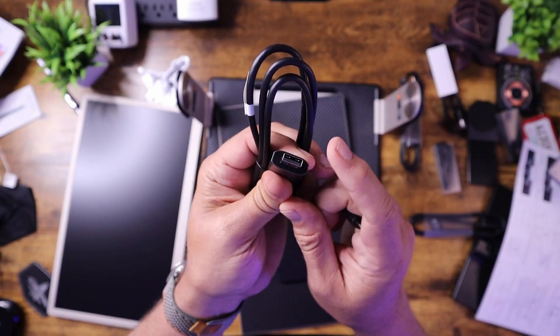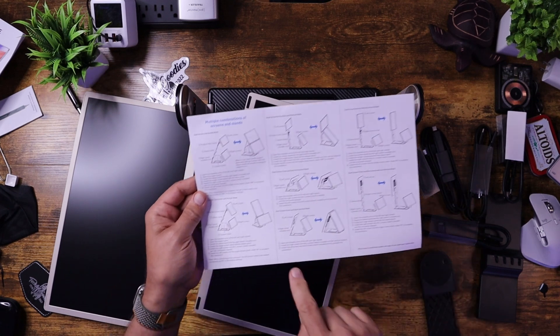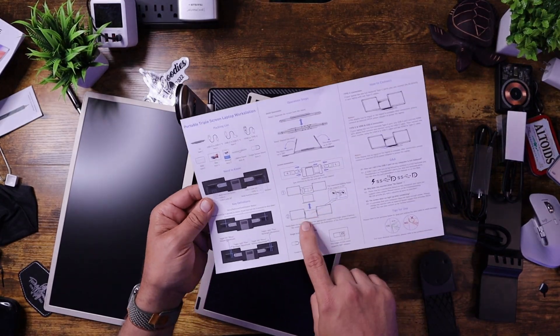The way they've set this up: they've got USB-C with DP on one port, Type-C1, Type-C2, and power. If you look at the cable, there's a little adapter with a DP port. So if your computer has DP out, you can use that, or you can use USB-C, or HDMI, or just plain USB-C. You need to know what your computer is capable of. You can also have it in a vertical mode, portrait above landscape, or a presentation mode with monitors facing outward, or the standard side-by-side mode.